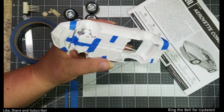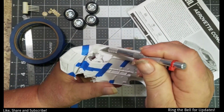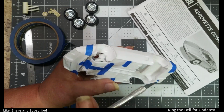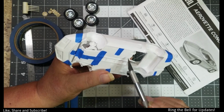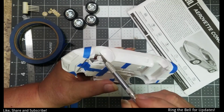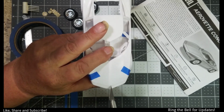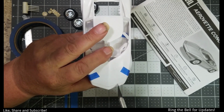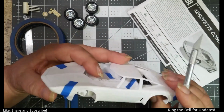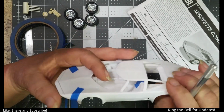So my thinking, pointer, is since you can't see this radiator up here, take and cut this right here, right above the spindles on both sides, and make this section and this section two pieces. That way I can slide this in under here, and then have this already slid in and slide it back and then glue it down. That way I can go ahead and fix these to the body, put a little Bondo in there, remake the seam where it's all the same, get rid of these holes, that if I sand long enough, I won't have any front end. The front end will be 3 inches higher than the hood. Same way with the back end.